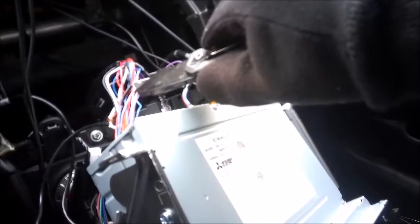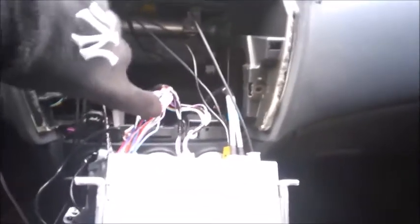I had to do trial and error and cut my brand new car's radio wires to find out. I'm old school, I just took my blade. I started with the blue wire first because everyone knows the remote turn-on for an amp is blue, but Mitsubishi has like four or five wires, so I just tried that first one.